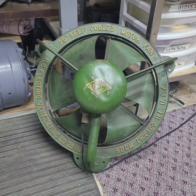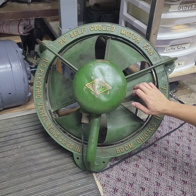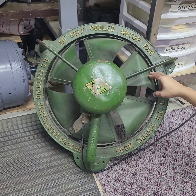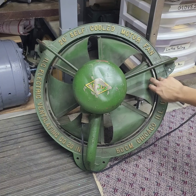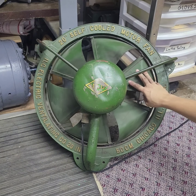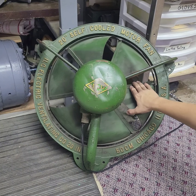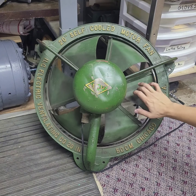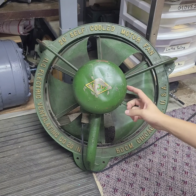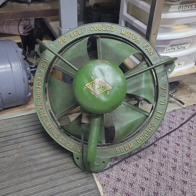There's no capacitor in this motor, so there's a little bit of vibration coming from the fan. Some of it may be from the blade. Sometimes, I don't know if it's necessarily the welds, but where the blades contact the frame of the blade, the bucket wings contact there, there's a little bit of looseness in some of them, as well as a little bit of vibration that comes from this cap. So we'll see how this run goes.